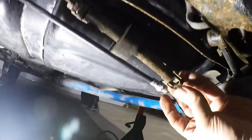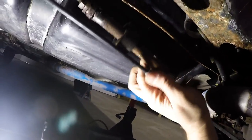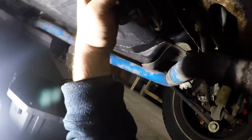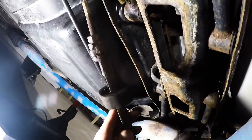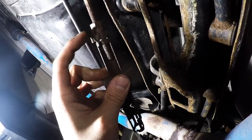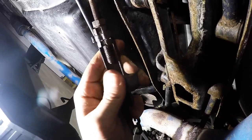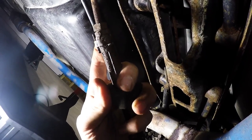This here, if you have slack and you get to here, then there's only cable. You can slip the cable through the end of this fork. Now this is pretty rusted. I can't get this nut to back off. So I think I might cut this band to have this bracket let go. And then I'll just put a different crimp clamp on to hold it together.